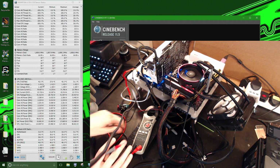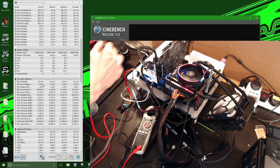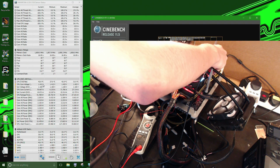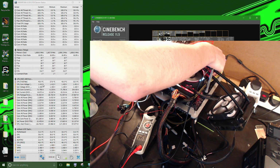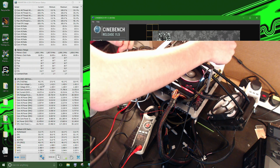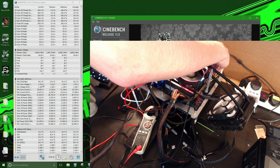And let's move this onto the output of the VRM, and I'll show you what the VRM will boost, because basically, well, it's best to see. There we go. There. So that's the VRM output. So the VRM is spitting out 1.45 volts instead of the, well, let's see, I'll try to get it off of the choke.